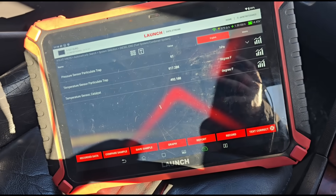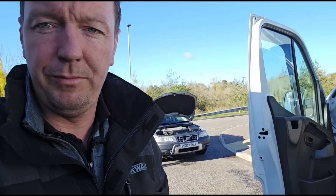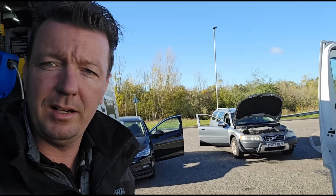We're stationary with revs up at just under 3000 rpm — that's the car doing its own regen. Most cars have a set amount of soot in grams that triggers a regen, but on this car I can't find that value. Now that we've reset it, it's immediately trying to do its own regen. What would have been happening before is it was regenerating every 20 to 50 miles trying to get the pressure down. Now that we've cleaned it and taken it for a test drive, it's immediately decided to do its own regen. That's it — all finished, Volvo XC70. See you in the next video.